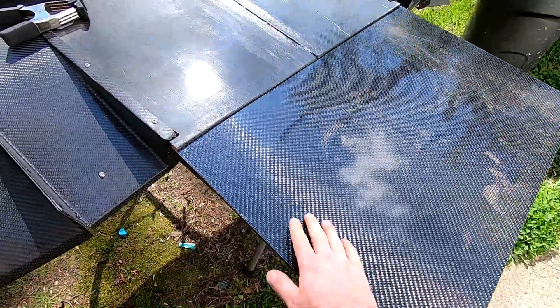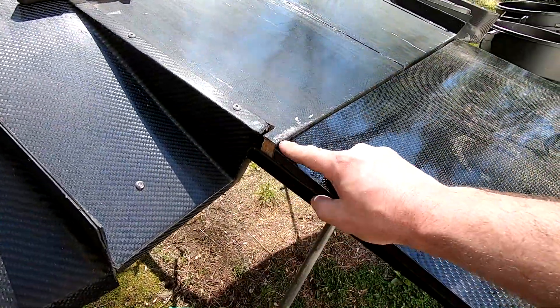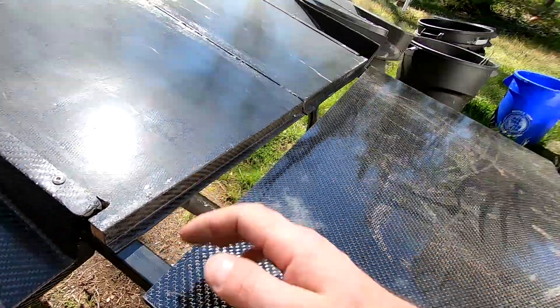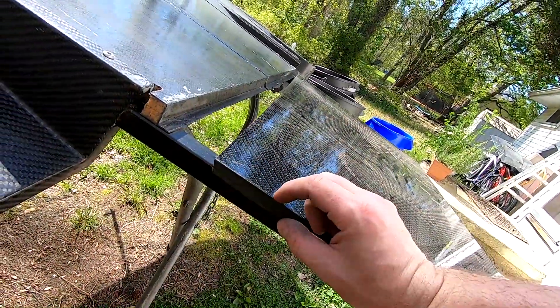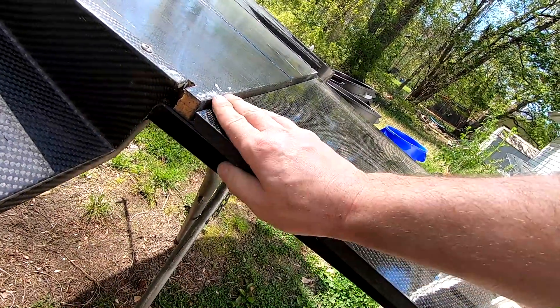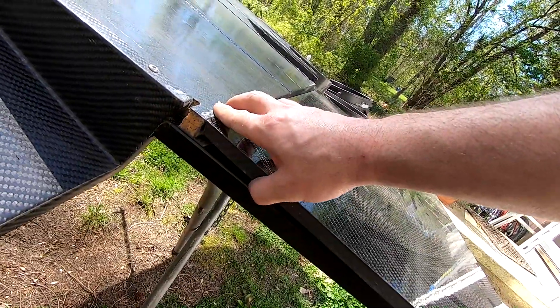Here's where we're at — you can see where this is going to go. It is thinner than the splitter, which I was well aware of going in, because our splitter was made one inch thick to make it that much stronger. With the three-mil SORIC and then the half-inch foam core on the side, I knew we were going to be a little bit short. What we'll do is when we drill our holes, just use a little spacer to make it even — simple. About three bolts each side and then this will be done. For spacers I'm just going to use washers to bring it up to flush.